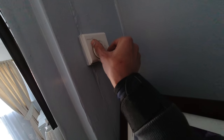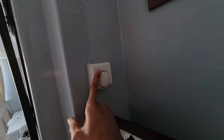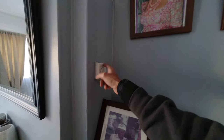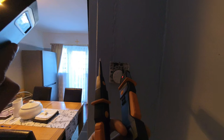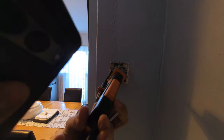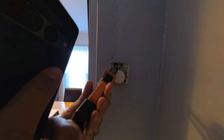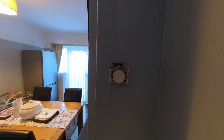Okay, so that's turned up all the way. Let's get this open and see if we've got power going to this — that'll tell us if the programmer is working at least, and then we'll see if this is sending power back upstairs. So room stat, let's check first. Do we have power at our common? Is there a neutral terminal here? Yep, number two. So we've got 230 on neutral. That's turned up. Do we have 230? Yep, we've got 230 on the switch as well. So I reckon it's going to be a dodgy synchro motor. Let's go and check the three port.